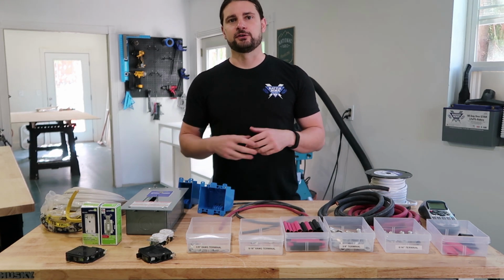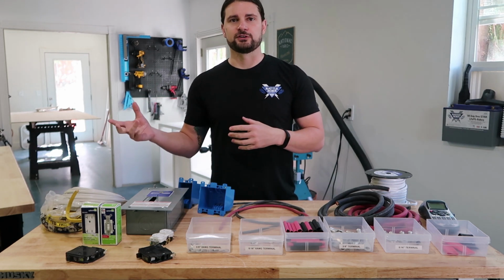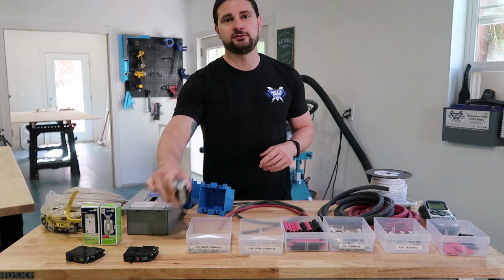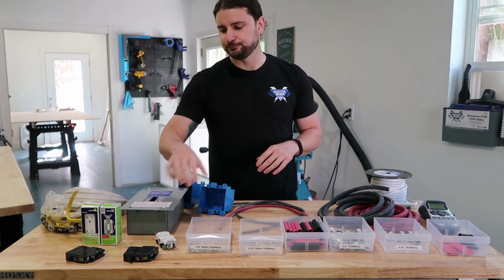All of my outlets that are used in the kitchen or underneath the bench, for them to be able to plug in their laptop and charge while they're sitting at their back benches working, are all coming off of a 15 amp breaker and are running to a 15 amp plug. And I like to use these water resistant plugs when I'm putting these around the van.